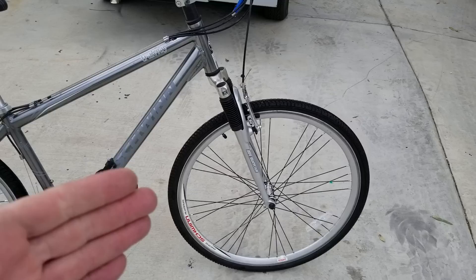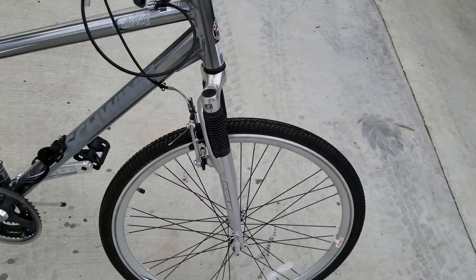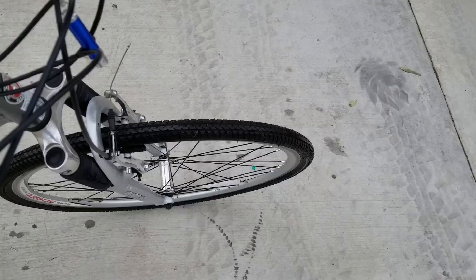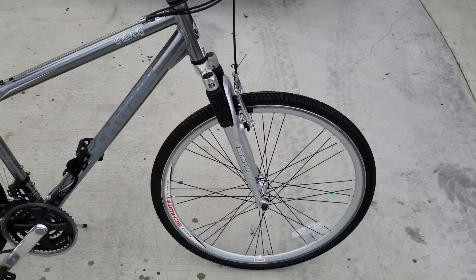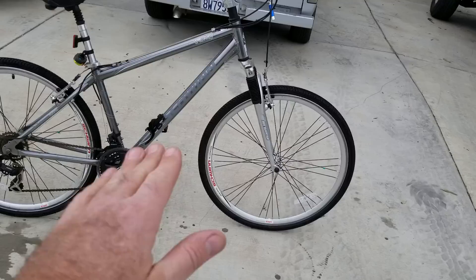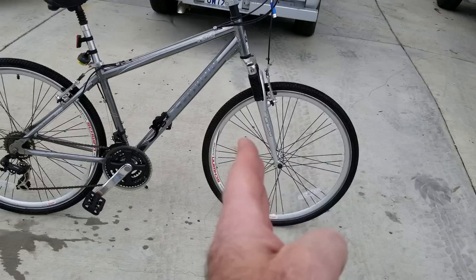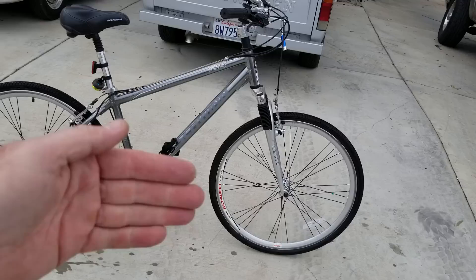Positive caster keeps your wheel going straight. When you used to turn your wheel around backwards, the bike was kind of squirrely — that's negative caster. When you have positive caster, it makes your vehicle more stable and wants to go more straight. The wheel centers better because it's like the axis of the weight of the vehicle pushes the front wheel forward and makes it want to go straight. When you have too much negative caster at a higher speed, you get the speed wobble — like a shopping cart wheel. Let's look at one.